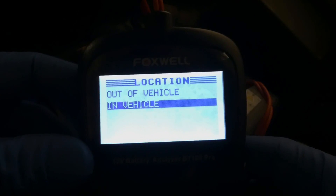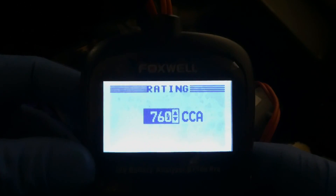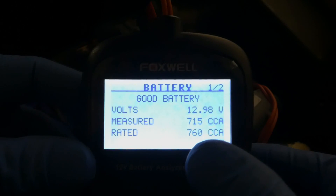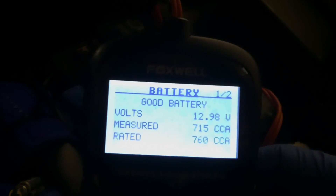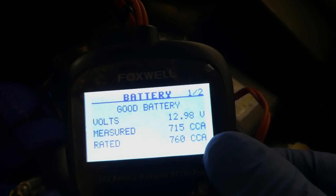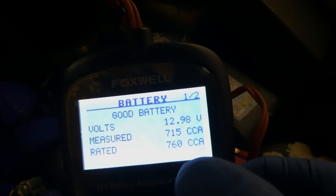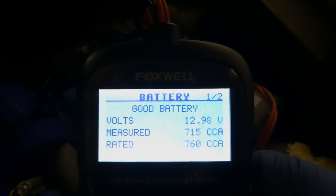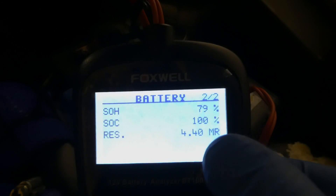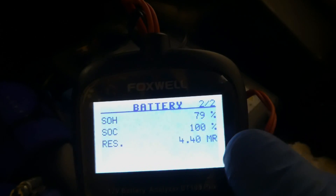If I do the battery test, and this time it's out of vehicle, regular CCA, 760 cold cranking amps. Last time it was 664 in-vehicle, and this time it's 750 cold cranking amps out of vehicle. I know this battery is quite good - it hasn't let me down at all and it cranks pretty quickly. So outside the vehicle there's some compensation inside the instrument.